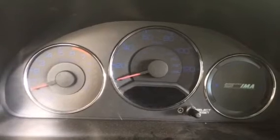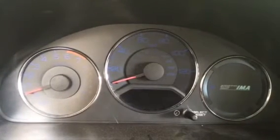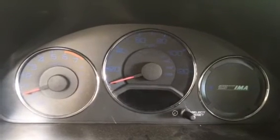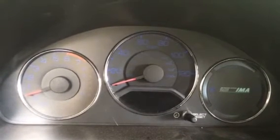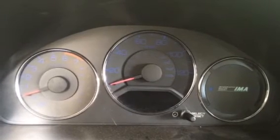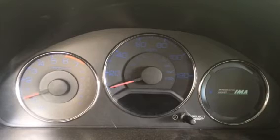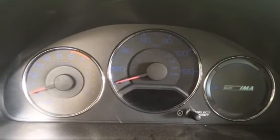We're going to let it sit for about six to eight hours, and it'll sit at a low voltage. Then the next time I run it before I park it, I'll have it fully charged, and that way you're basically flexing the battery pack and maximizing the overall lifespan of the battery pack. Thanks for watching, enjoy.